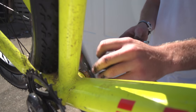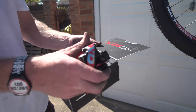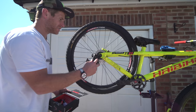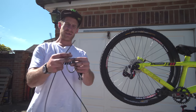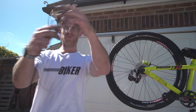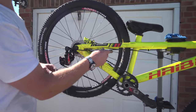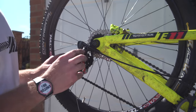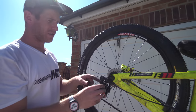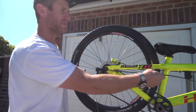Let's worry about the gears now then. I'm going for this nifty little number - this is a SRAM gear system with a short cage, and that's going to fit on there really nicely. It's now time to fit the gear shifter. So I now have a customised, modified gear setup. The reason it's modified is because there's only five gears - I had to use the limit screws to stop it from going any further so it doesn't get smashed into the wheel.